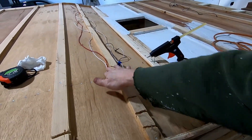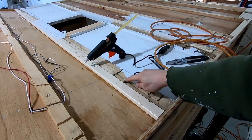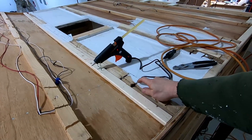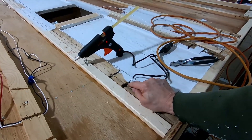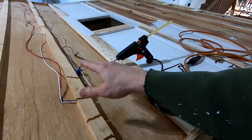What I'm doing is hot gluing down the wire harnesses instead of stapling. The original manufacturer stapled everything in here, which I guess is fine, but my track record on stapling is pretty bad — I've been known to run staples right through wires. So in this case we're just going to hot glue things in place.